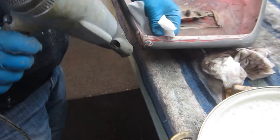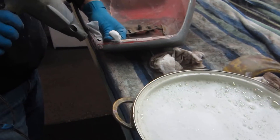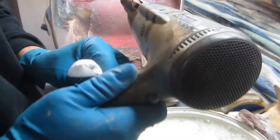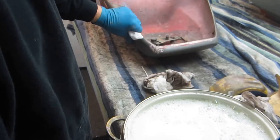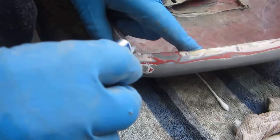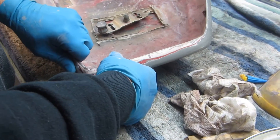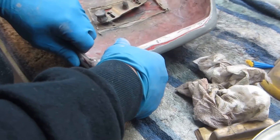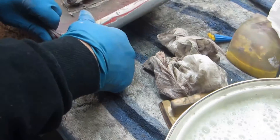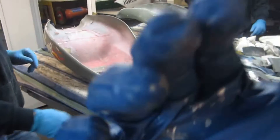What do you got? A little crack back here? I just want to open it up. It's time for you to do it on your own. Open the crack up. Dry it with a hair dryer — it's capillary, it's going to go right in. Just wipe it with a clean towel, press it together, hold it for two seconds. And if you're lazy you can take a little bit of accelerator — the kicker — and just let it sit. In a case where you've got a crack, put some material in the back, get it from the inside, the same thin CA — that'll wick it in from the back too. I don't want Steve at ECS to say you guys wrecked my bike.